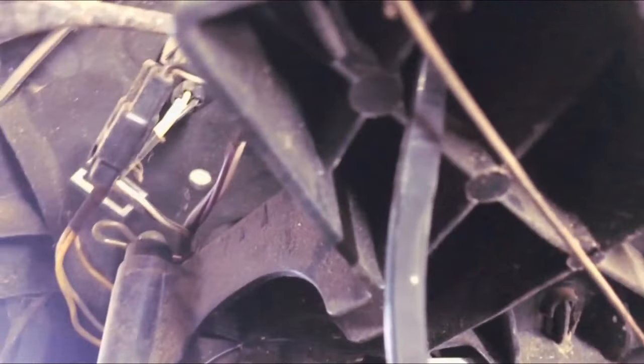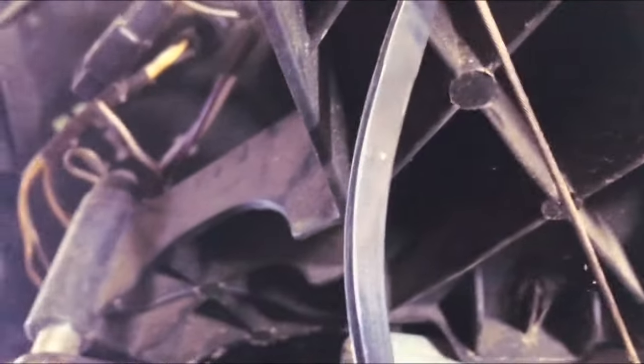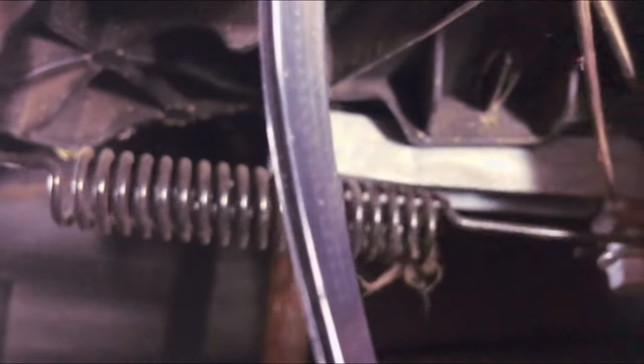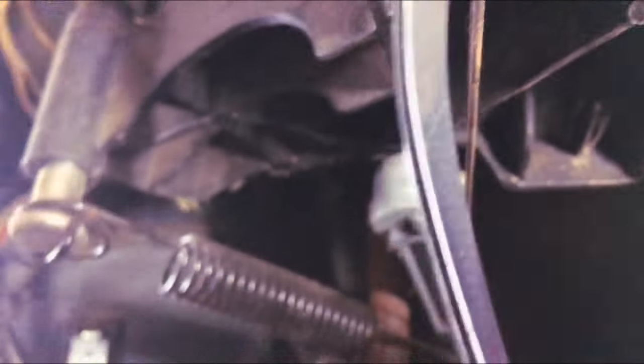It's on the left-hand side when you're sitting in the seat. The contact for it is up under there - it's fairly clampy on your fingers so you've got to watch out as you pull it around that you don't get your fingers stuck in there while you're trying to sense where the switch is. This big aluminium thing coming around touches on the switch just up behind there. With the power takeoff on you can get your hand up in there - you can probably take that connector out and put your multimeter on the pins and see what happens when you open and close the power takeoff to make sure it's actually doing what you expect. That wasn't our problem in any case.